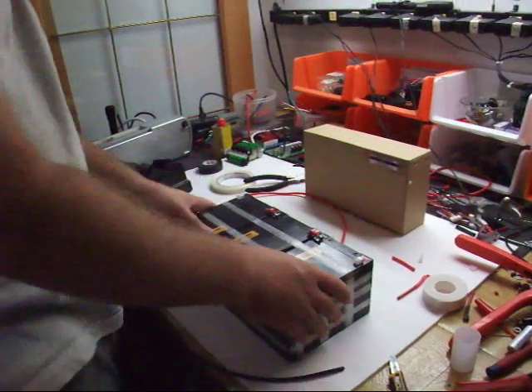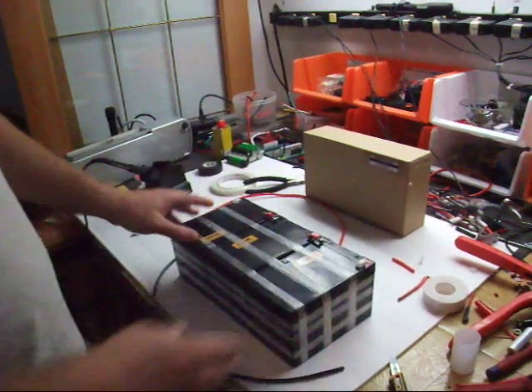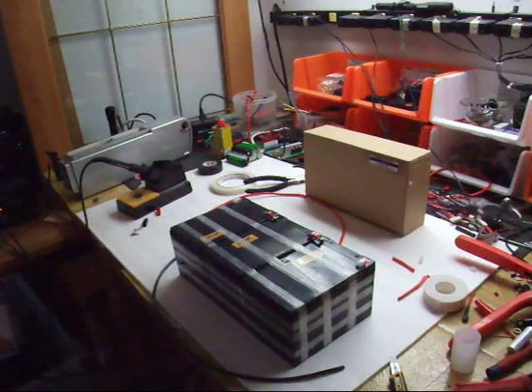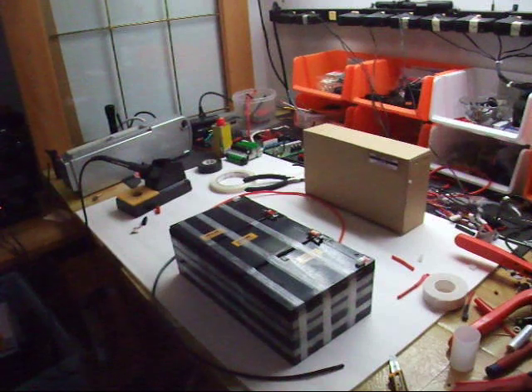Right here I'm making a 36-volt lead-acid battery. You'll notice I got three bricks — they're 12 volts, 12 amp hours each. I don't often build lead-acid batteries, but in this case it's going on a trike that only needs to go less than five kilometers, with a Crystallite 409, 36-volt, 12 amp hours of lead-acid. It just makes sense in this case.